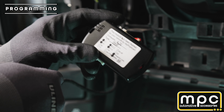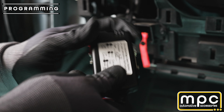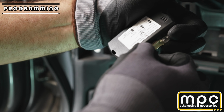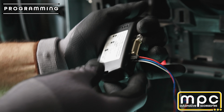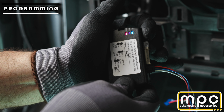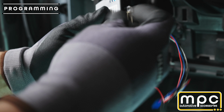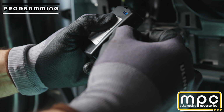Okay, we're ready now to program this module. To do so, we're going to press and hold down this program button, and keep holding it down. While holding it down, you plug in the black 4-pin connector. The lights are going to flash, and we want to let go when we see a solid single blue light. There we go. Now you plug in the white 5-pin connector.